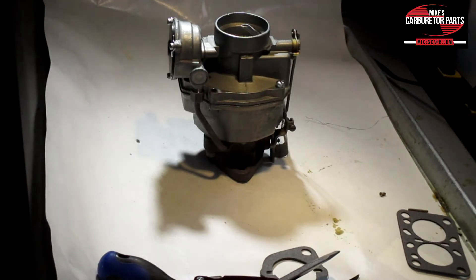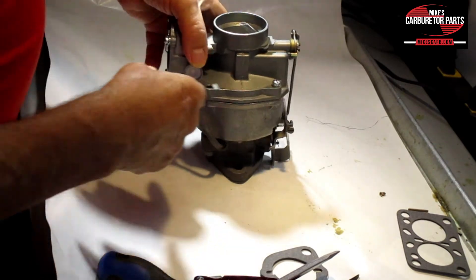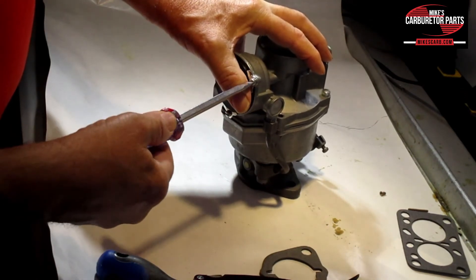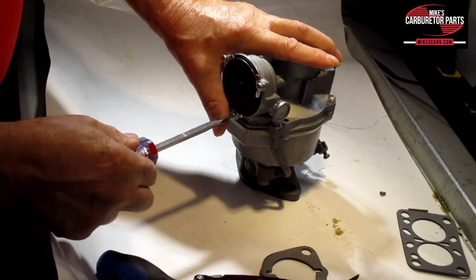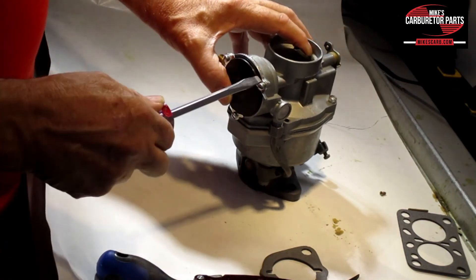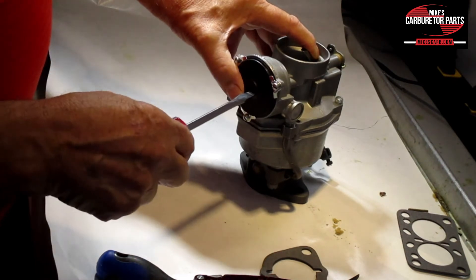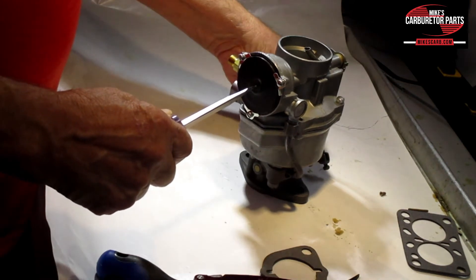That's the float adjustment. Now we're going to do the choke adjustment — you should do this before you do the choke rod adjustment because that will change it. First thing we've got to do is loosen up the thermostat here. A lot of thermostats will have an index mark, but a lot of these are retrofit through the years and they've consolidated a lot on chokes. This one has no index marks. Personally, I don't like the index marks anyway — these things are 60 to 70 years old and worn, so I just don't think the index is going to work like it used to.